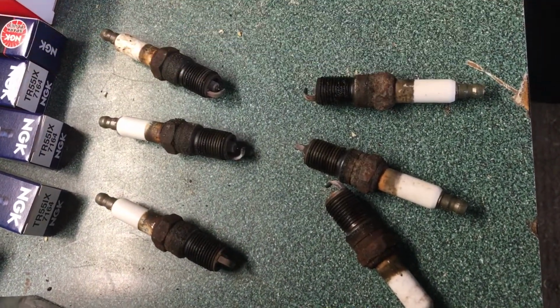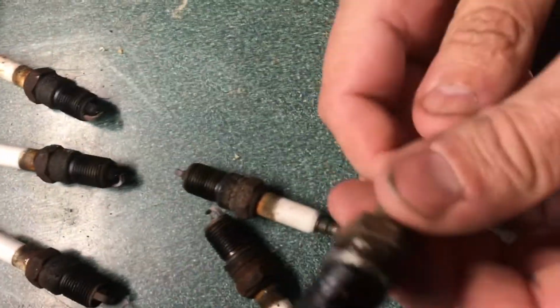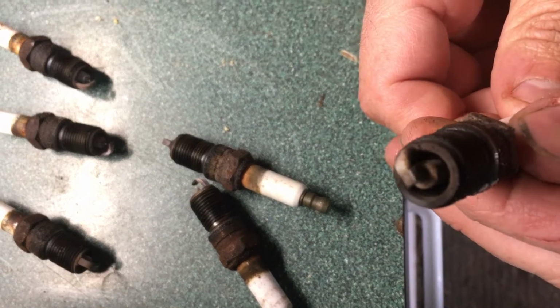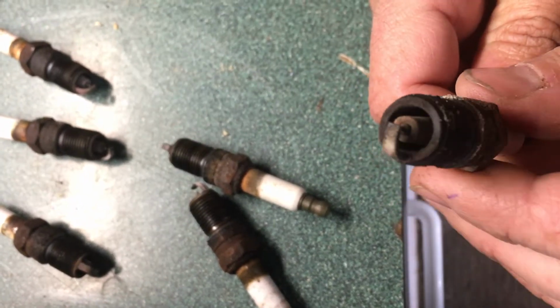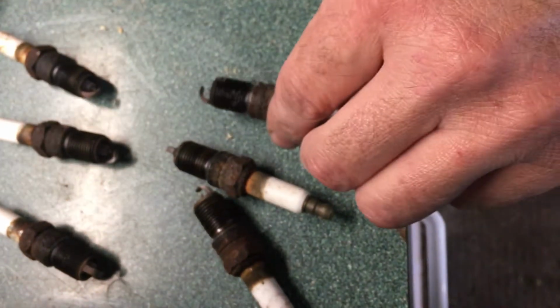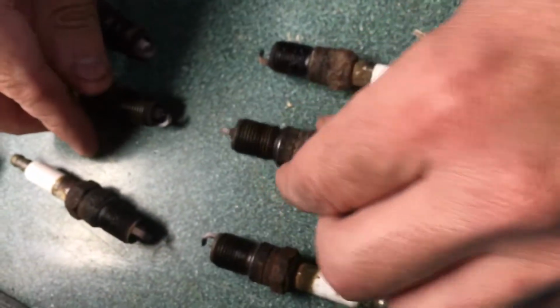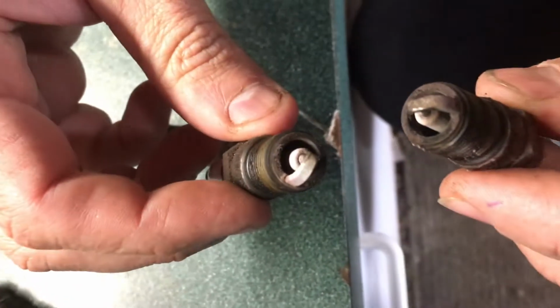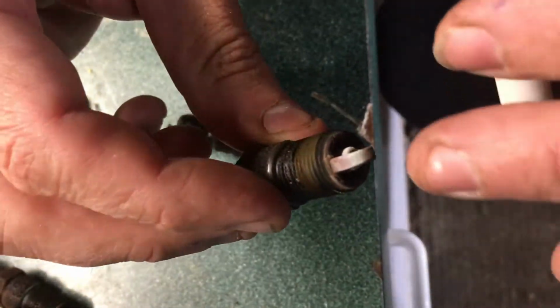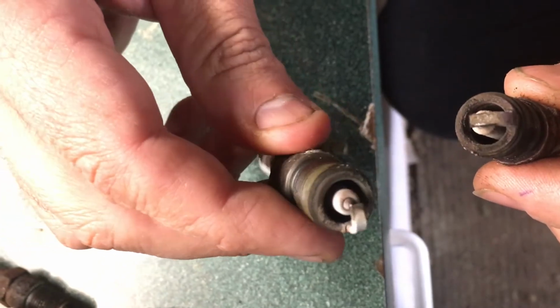And then reading the spark plugs, this spark plug, if I put it on screen, is okay. It's a little bit orangey, just a hair, a little bit of white. I think the white means it's a hair lean. I've got 2 cylinders, 2 and 4, this one especially, that I might want to start looking at the injectors for. Everything is pretty much the same except this one's got a little bit more white than all the others.